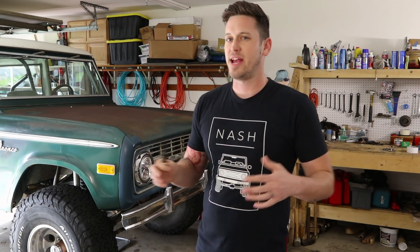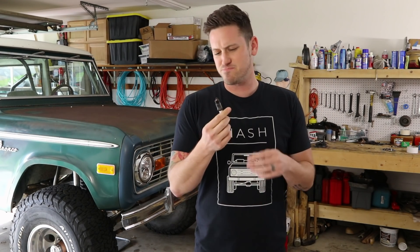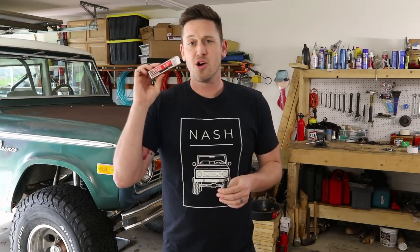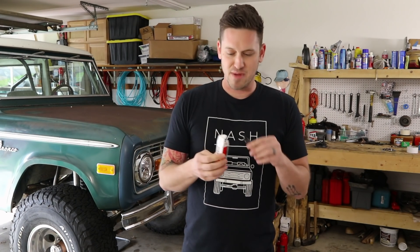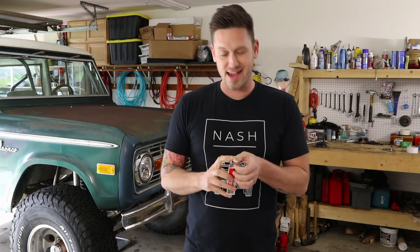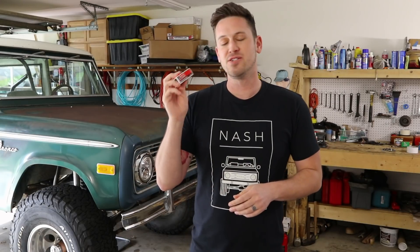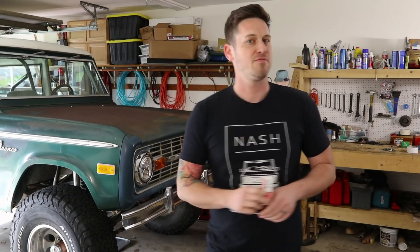Number two: the basic spark plug is going to be great for your 302 or your 289. Now if you're running 700 horsepower, then yes, get the spark plug with plutonium and kryptonite lead-based goodness in it. I buy Motorcraft spark plugs — I'm not sponsored by Motorcraft or anything like that, but they're Motorcraft plugs and Ford kind of sort of makes Motorcraft. So I just get the cheap Motorcraft plugs.